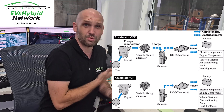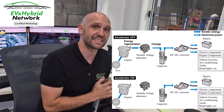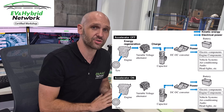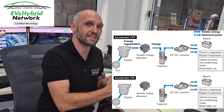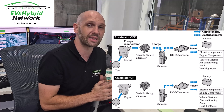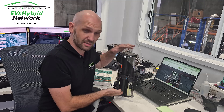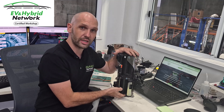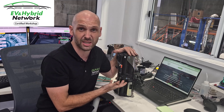So why do they use a capacitor? You can almost instantaneously charge a capacitor — a battery takes a much longer time to charge, whereas a capacitor we can charge very, very rapidly. The downside is we lose energy density. This is quite a large looking unit that they hide behind one of the headlights, yet it holds nowhere near the energy capacity that a similar sized battery typically would — whether that's nickel metal hydride or particularly lithium ion.